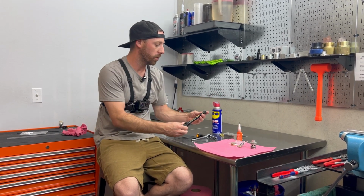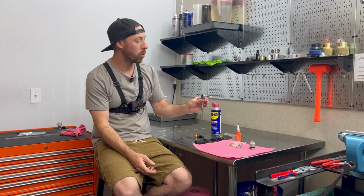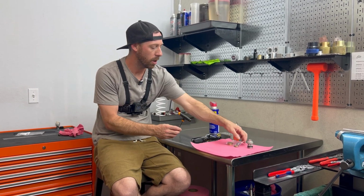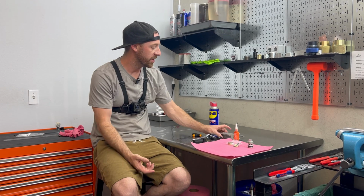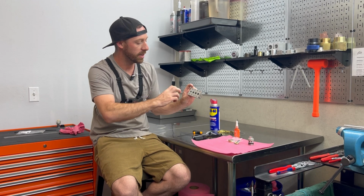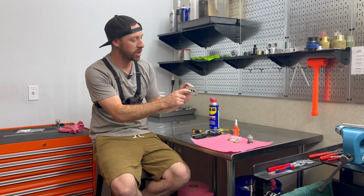You're going to want a 1/4 inch torque wrench. You're going to want a regular small 1/4 inch drive. Here I have a very small 2.5 millimeter T-handle. I'm going to use this to slide on all the shims and keep them in order when I remove the zip tie. These are very important. These are some shaft holding blocks, and they are going to hold our component from spinning when we go to remove it. Specifically, we want the 12 millimeter size.